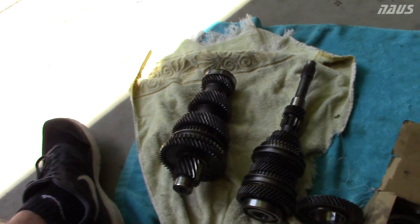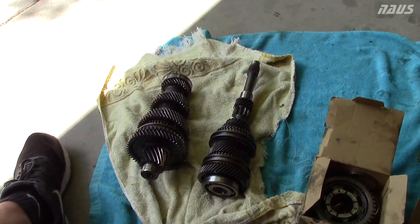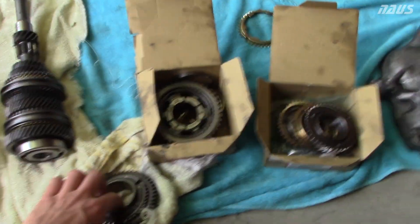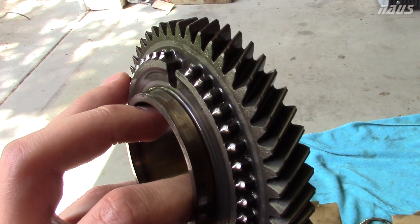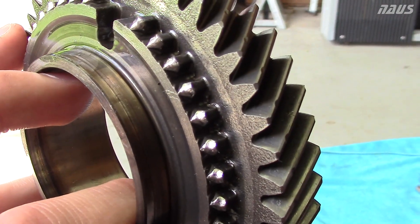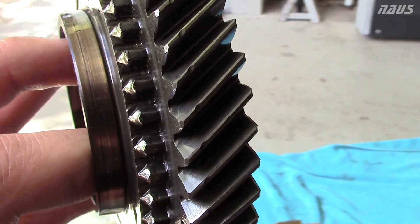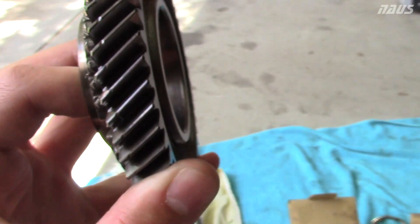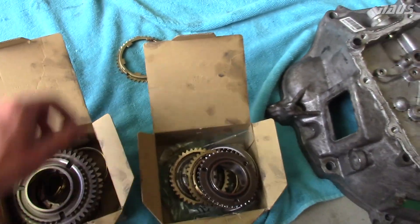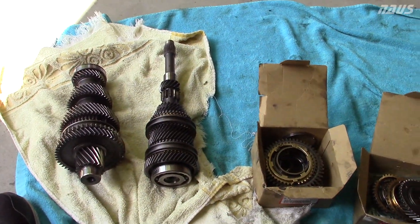If your car is grinding second gear badly, changing your transmission fluid is not going to help you. It might make you think it's fixing the problem but it's not — this is your main problem. Every time you grind second gear really hard you're contributing to this problem, and the more you grind it the worse it's going to get, to the point where this one is where it barely would go in at all. That's just a quick video to show you why your second gear grinds and what happens to it. Thanks for watching, subscribe, and I'll see you next time.